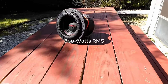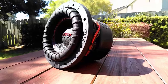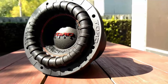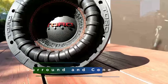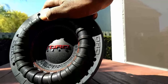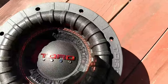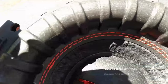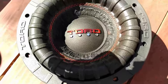For your money, Toro provides a non-pressed front-facing reinforced paper cone, but keep in mind the rear of the cone is pressed, which you will see in this inspection later on. The two and a half inch copper voice coil is protected by a customized dust cap that is fairly strong and visually appealing with geometric shapes and raised lettering. The cone is supported by a high roll surround which is ribbed to ensure linearity, secured with double red stitching and glue to increase its durability.